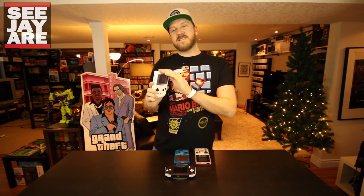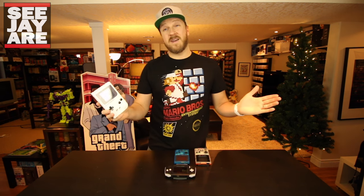In the case of the DMGs, what I do is I give them a new housing. This one is my favorite — this is my personal one. I call this the Stormtrooper. Just black and white. I like mine pretty simple and plain. I absolutely love using this — it's really brought me back to playing more Game Boy games. So: case mod, glass lens — you can find all these things from Handheld Legend, link in the description below — and then I put a backlight in the screen and a bivert chip. Bivert just kind of biverts the black and white pixels and gives you a lot better contrast.